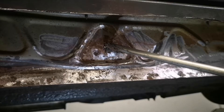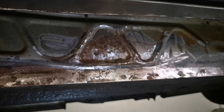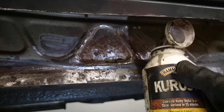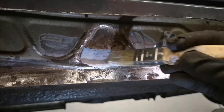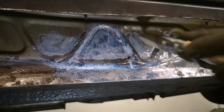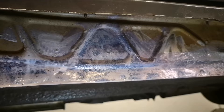This area here is a little bit corroded - it's really strong still, we've caught it in time, but there is a little bit of pitting. I'm going to use some Hammerite Kurust which is meant to convert rusty metal into a clean surface. I've not really used it before so we'll see what it's like. You clean the metal and apply it with a brush out of a pot. It's over-paintable so I'll prime it still - just trying to give it a chance. I need to leave that for 15 minutes and see what happens.